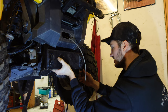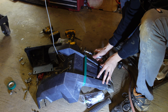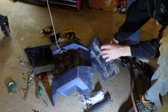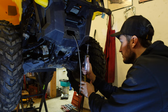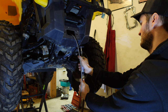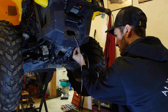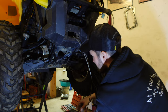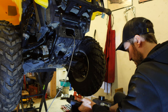Safety squints engaged. Well, that sucked, but the deed is done. Just got to get this one edge a little bit. What we're going to do is actually mount the bracket first and then trim the plastic to be flush along the top of it — I feel like that's just going to be the easiest thing to do at this point. Unfortunately with how we had to do it, I'm not happy about having to trim the plastics, but tis what it is.